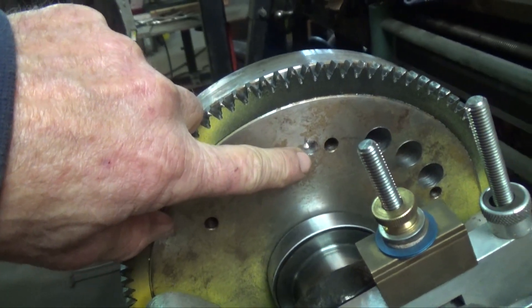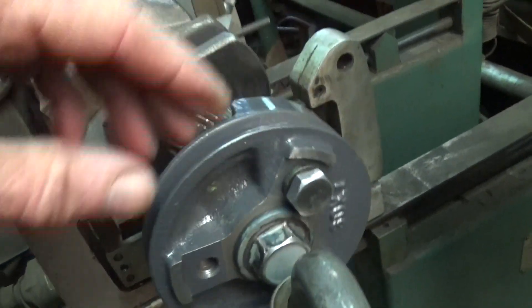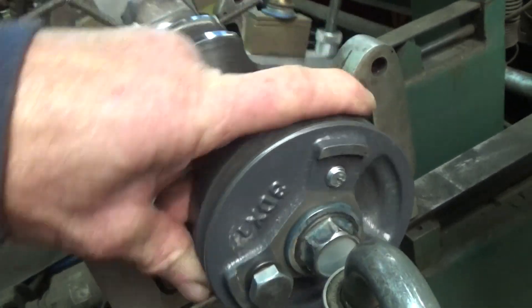It's a lot of work, but it pays off for smoother running engines. It's a lot easier on everything and helps make more power. To get it balanced you either add weight to certain parts, or it's better to take weight off. A little hole here we drilled to get it finely balanced. On this end, I actually had to add weight to get it in balance.